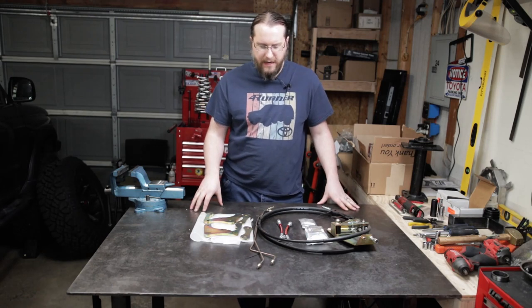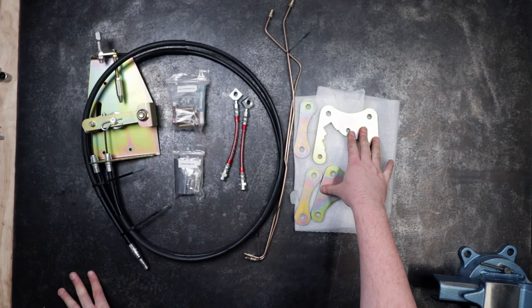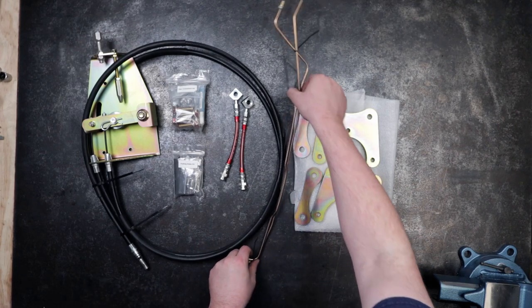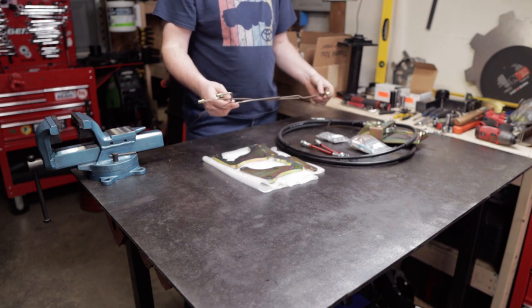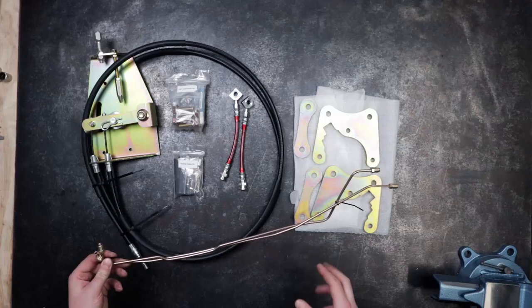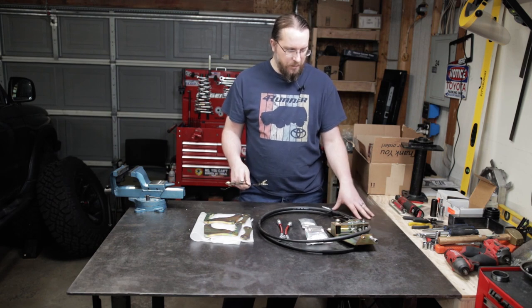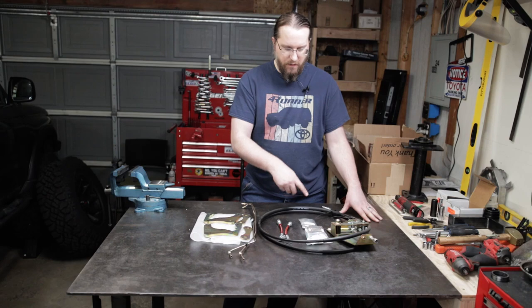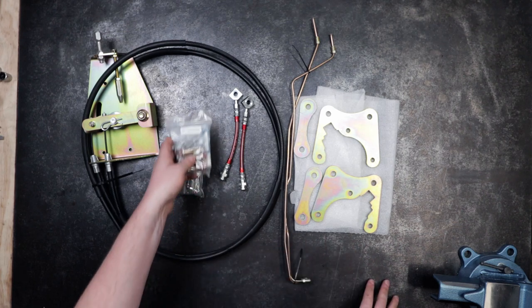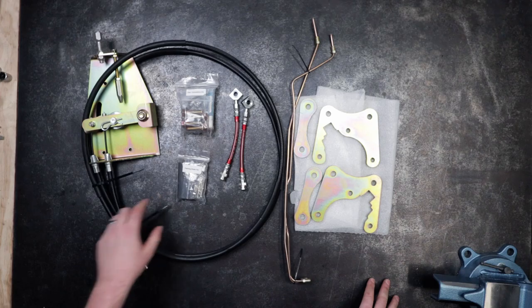I've got everything laid out for this rear axle disc brake conversion. You've got the brackets that hold the calipers, and then some spacers that space them so they fit over the disc brake properly. With my kit you can choose optionally to get some hard lines to replace your factory ones. My goal is to potentially convert back to drum brakes, although doing the parking brake conversion excludes that essentially. You can get a factory replacement for the parking brake line. The kit comes with all the hardware you need — it even includes blue Loctite. It's a really complete kit, and it also comes with the rear parking brake conversion hardware.